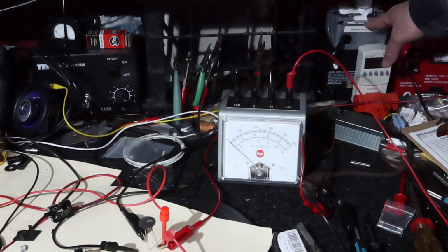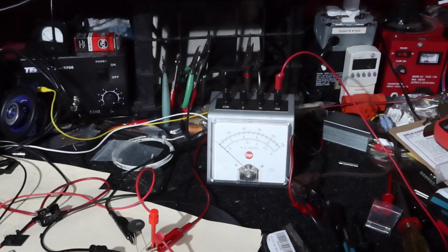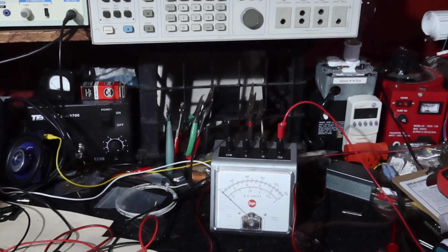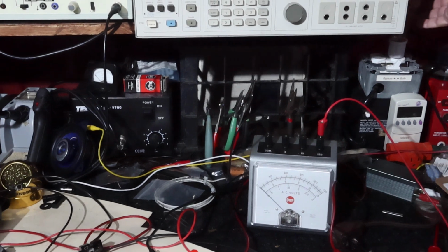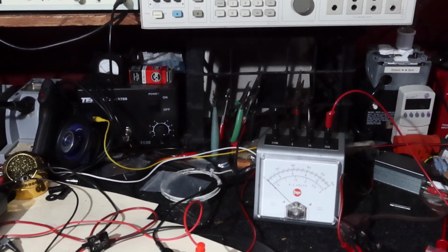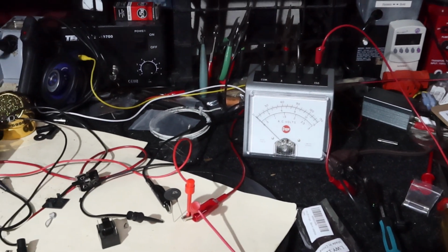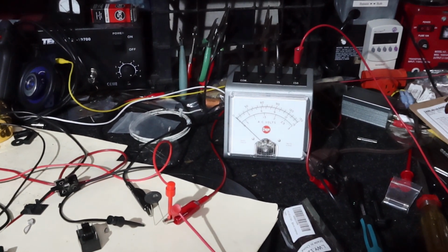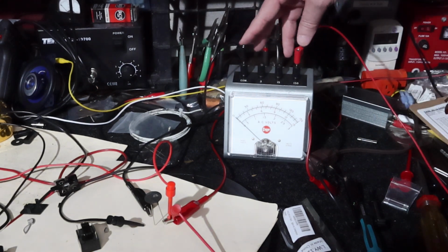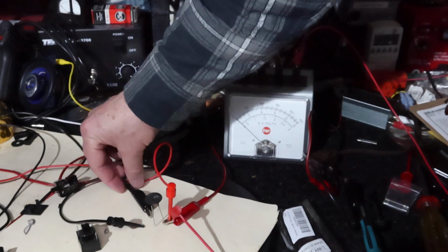This is a dim bulb we have back here. There's a light bulb back there. I think I've got a 150 watt bulb right here. I can vary that depending on how much power requirement I have for the various tests I'm doing. Okay, now what I've got is I've got this rigged up to where I'm going to be measuring voltage across the CL90. But what I want to do is show you what the dim bulb does.